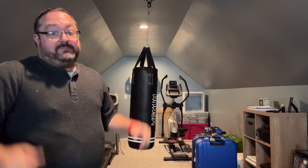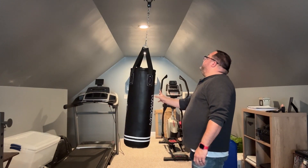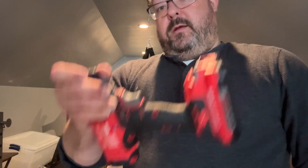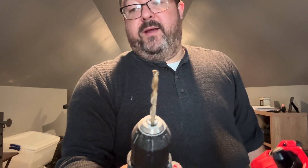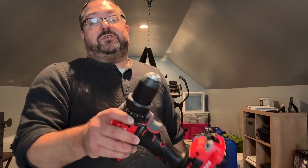Didn't take too long. Let's be real about this — I had all the tools necessary. As long as you've got an impact driver with a socket adapter, a 13mm socket, and a drill with a 7/32-inch drill bit, you're set. I used a 7/32-inch bit and it was perfect — you might be able to use bigger or smaller, but that's what I chose.